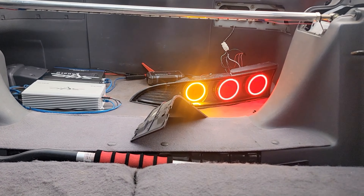Follow the gray and red wire up to this plug. Since we cut that gray with blue wire there are two sides — the side feeding into the harness has the brake signal tied in. The other side should still be a live flasher signal. Run a new wire — a different color helps you stay organized — up into your outermost bulb, which will be the amber bulb. I'm not a mechanic or electrician, just some kid. All the stuff I found online I couldn't understand — I had to read forums from 20 years ago and watch a couple of videos, so I'm trying to make this as easy to follow as possible.